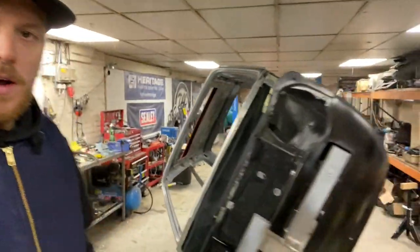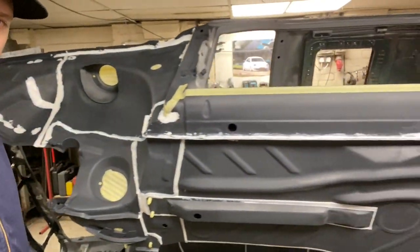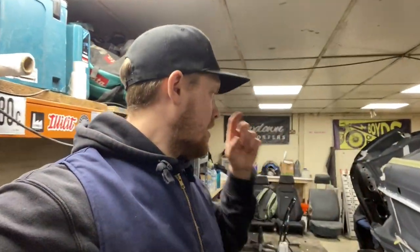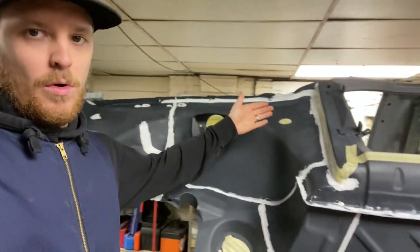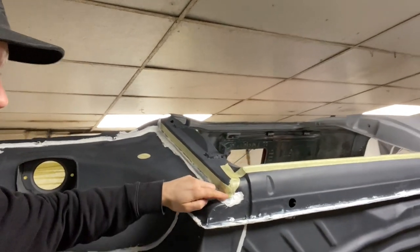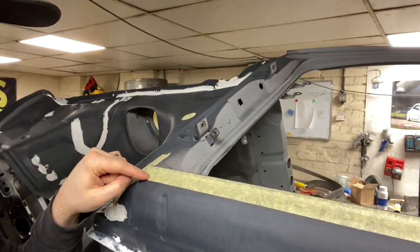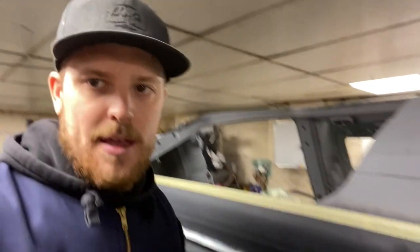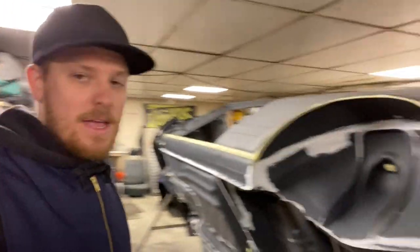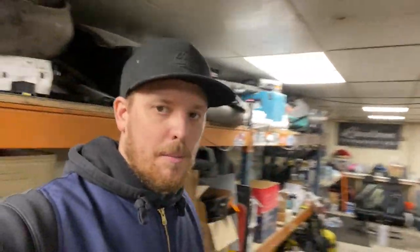Welcome back - Monday morning, we're back in. Seems the sealer is all dry now, car is all rolled over and Richard has made a start on masking. We're masking all the holes out where we don't want the underseal to go through, masking threads and things. We've picked a few lines of where we want to run the underseal up to, and we've decided that the line of this sealant here is going to finish about 5mm below the trim that sits in here, just so that looking down you've got a nice paint finish.